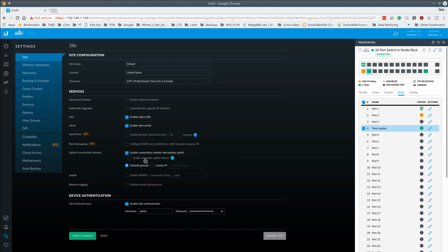And this is a really weird but neat feature. If you have a wireless device that gets broken off from the network, but it's within range of another Wi-Fi device that is on the network, which means it got disconnected from the network but is still powered on, and of course if they're PoE that doesn't usually happen, but it can, it can then identify, diagnose, and set to a bridge mode across the antennas to keep extending the Wi-Fi network without a physical network connection. It's kind of like a mesh system. It's kind of clever that they built these in. I find it really interesting.